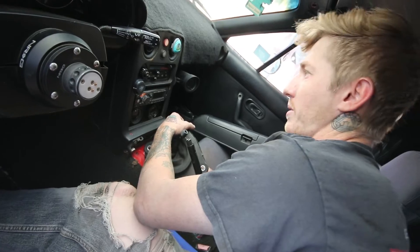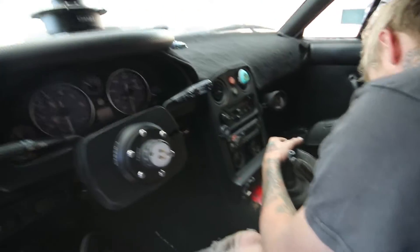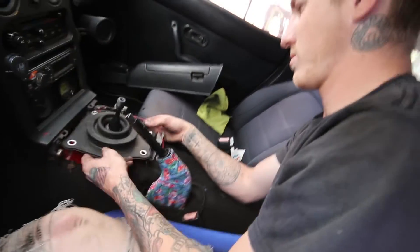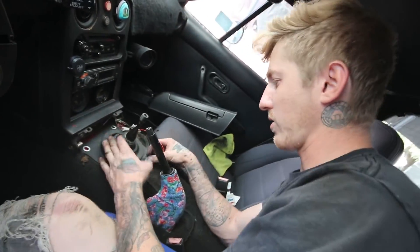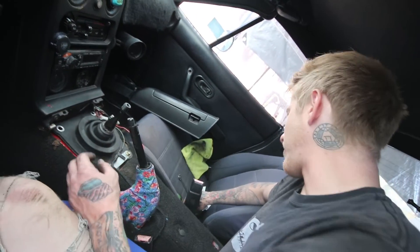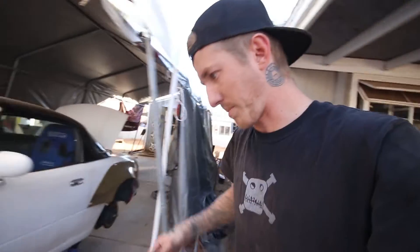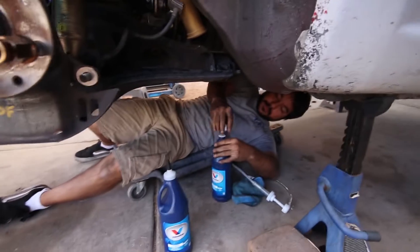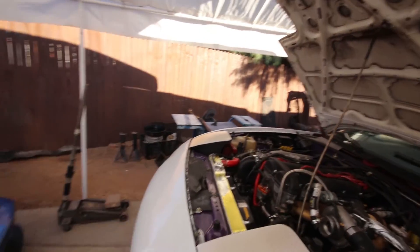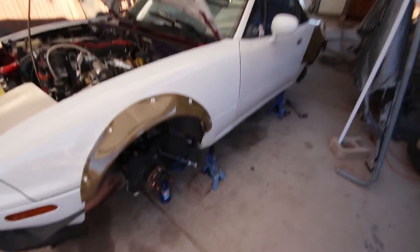Everything else is done — the underside is finished. The only thing left is to fill the transmission with fluid — it takes two quarts, filling to just about the fill plug level. Once it's filled I just have to attach the mid pipe and this thing is ready to go. Ready to rip some clutch dumps — or rather, ready to grandma drive for 300 to 500 miles to break it in. I still have to put my turbo blanket back on and order rotors since I'm not going to put new pads on the trashed rotors.